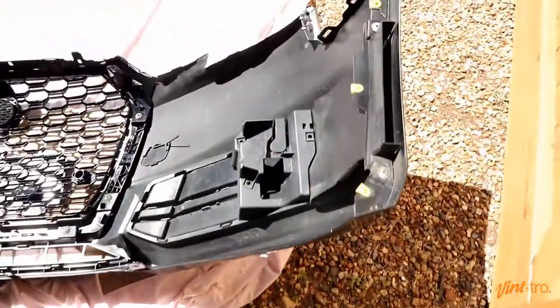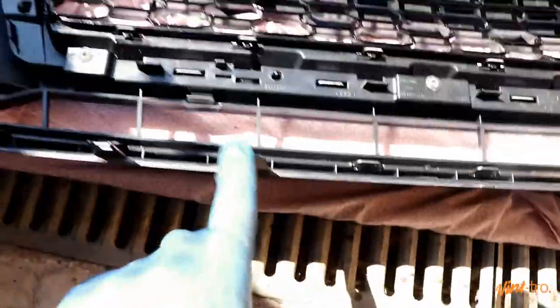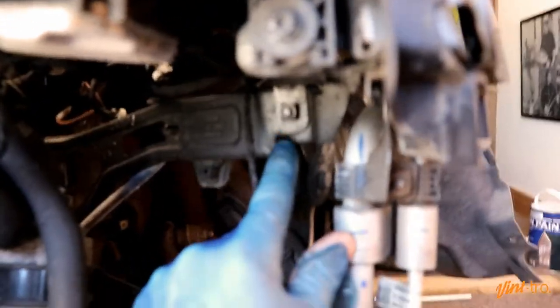If you look at the bumper, it's got all these locating points here and so on. There's 1, 2, 3, 4, and again this side, just these locating screws. And then we're going to obviously tie it to the splash guard underneath. Just to make it easier, I've got my three screws here, my main bumper screws, so there's four on the edge, and then at the bottom of the car here, 1, 2, 3, 4. And then my three screws here, and then my main bumper screw there. So they're located into these places here and here.